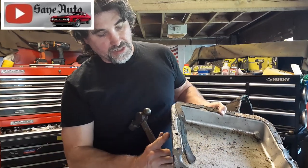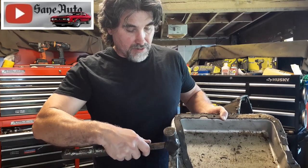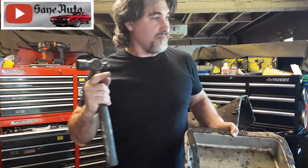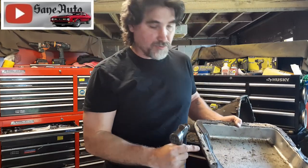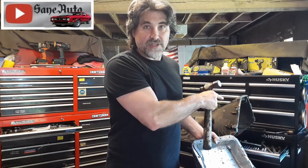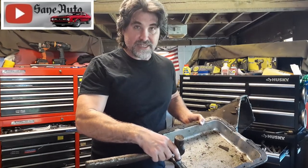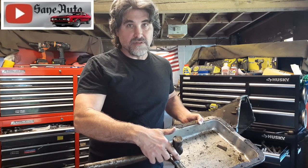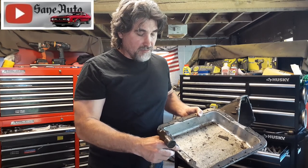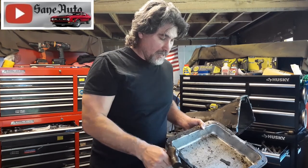You want to get rid of these divots where the bolt has been tightened up several times and it's pushing up on the spot where the bolt goes through. Take a ball-peen hammer and set the round part squarely on the hole. Find the edge of a nice strong table — like a stainless table — and lay it on the edge. Get close to where the leg is so you're not bowing the table. Take a second hammer and smack the hammer medium — not hard. Do it a couple of times till you get it nice and flat. If it goes a little bit beyond flat, that's not too much of a problem, but don't make it convex the other way. You just need it mostly flat, then don't over-tighten the bolts.